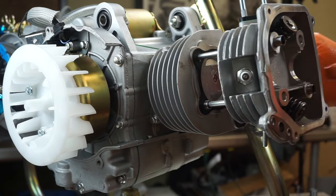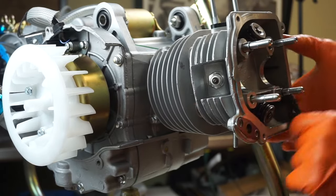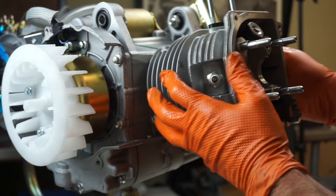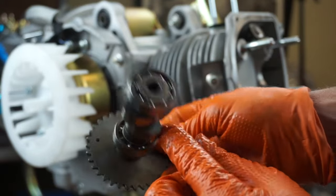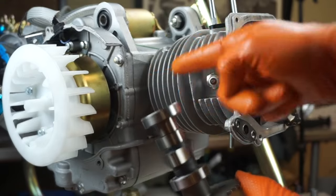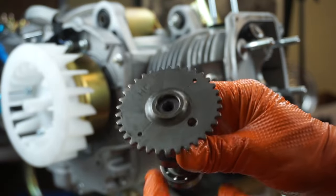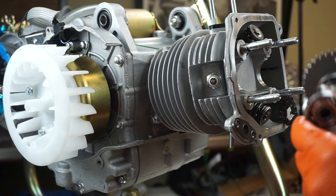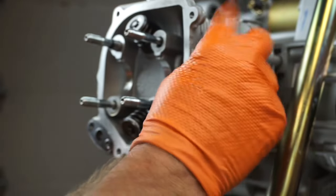Make sure your timing chain guides don't get in the way, then pull your chain through and give the cylinder head a little wiggle until it's nice and flush on the cylinder. See these cam lobes? You want those down — the lobes pointing toward the engine. You've got a line on the cam sprocket, and the goal is to match that line up with the line on the cam tower, with the cam lobes down.